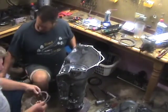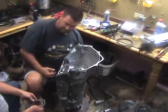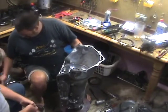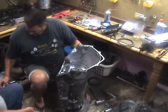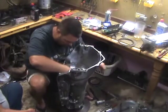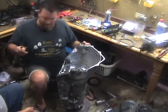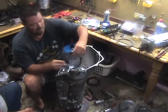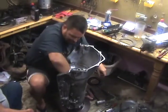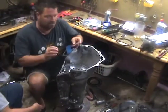You put your clutch on the floor, and then you're basically going to put your clutch in there after you've lubricated it. So you've got another steel. I'm going to the next steel. As you can see, my dad's there. He's basically sticking them in and lubricating them as I pull them back up. So that's all he's doing. Nothing special. But put another clutch down. I probably should have counted these for you, but you'll basically figure it out. Like I said, if you keep all these in order, you're not going to have a problem with it. It's when you get everything out of order. So what I always do is I make sure that I don't get anything out of order. So here comes the steel.